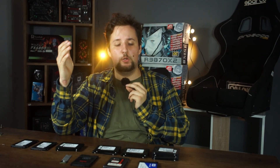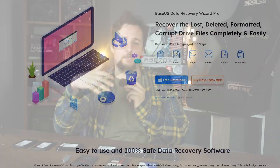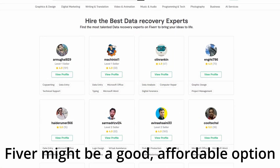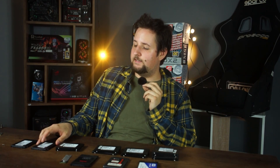Same thing for M.2 — if it doesn't work by the third try, the drive is probably dead. If that didn't work for rescuing your data, you could use data recovery software, or take it to a recovery specialist if the data is really important, because sometimes these data recovery tools can make things even worse than they were before.